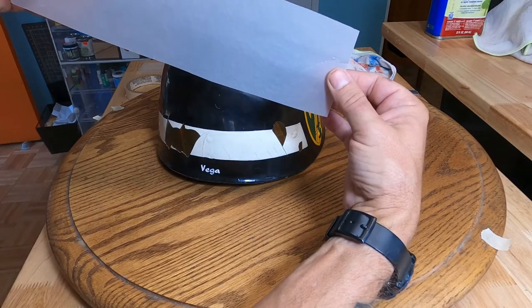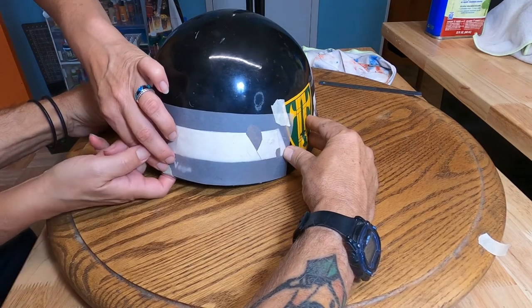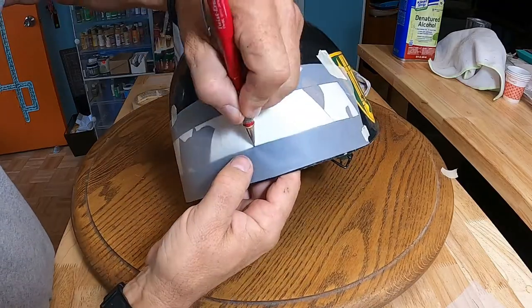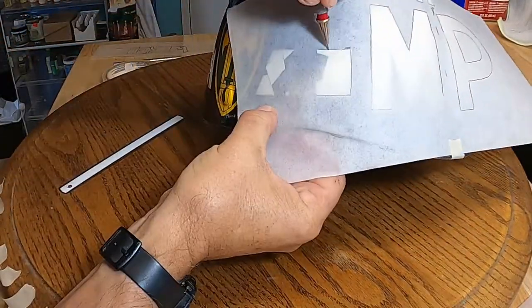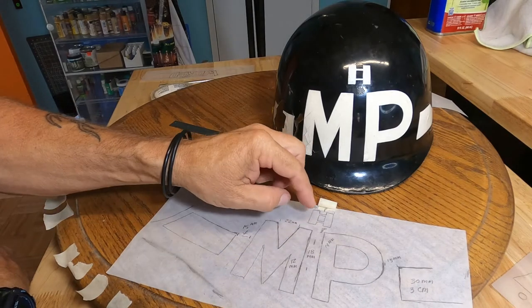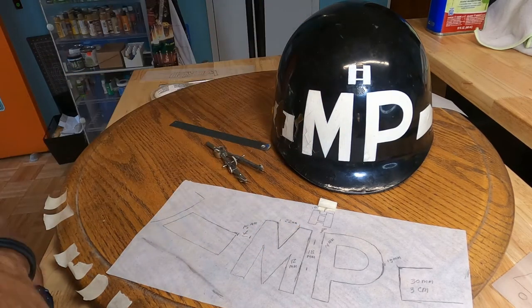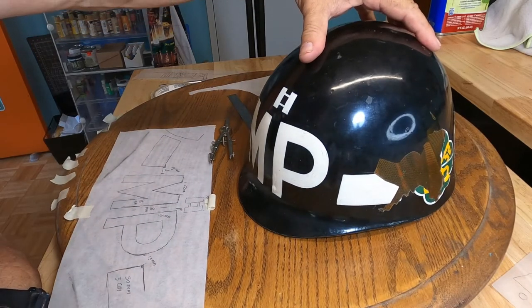I put a very slight curvature in the tracing paper because I want it to be exact. With the assistance of Roswell, I'll know exactly where these graphics go and they'll be in exactly the same place they were originally. With these tools I've gotten precise measurements of the size of the letters, the distance between the letters, and the distance between the letters and the stripes — I've really documented this thoroughly. As you can see, before you even start taking the old paint off, you need a lot of good documentation to get the best restoration possible.